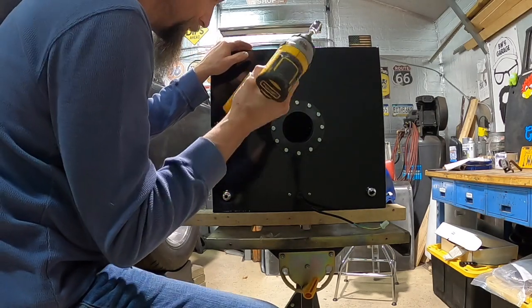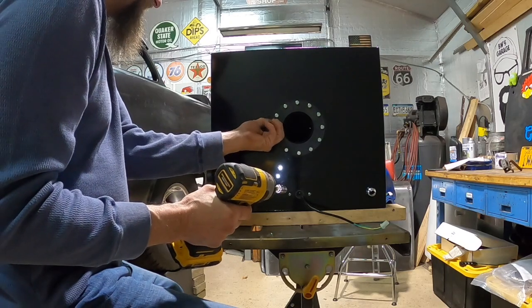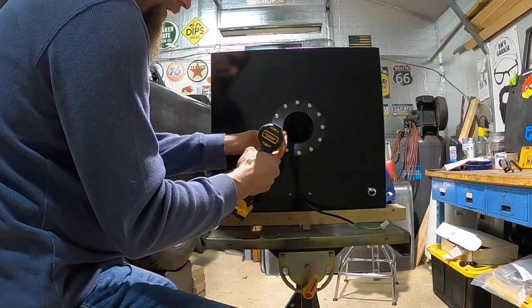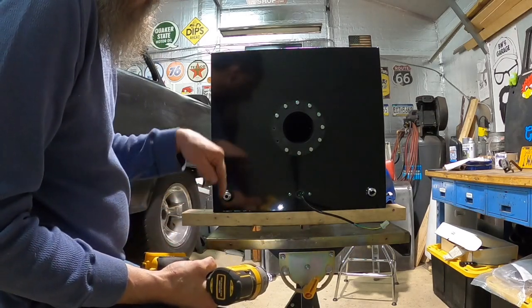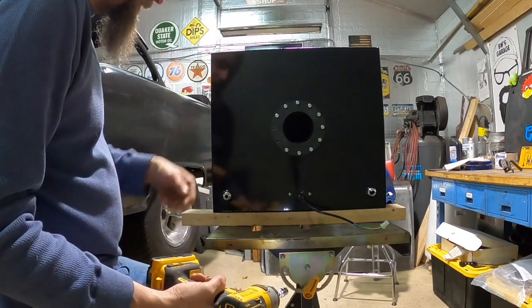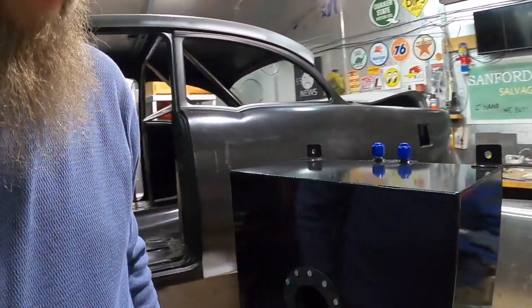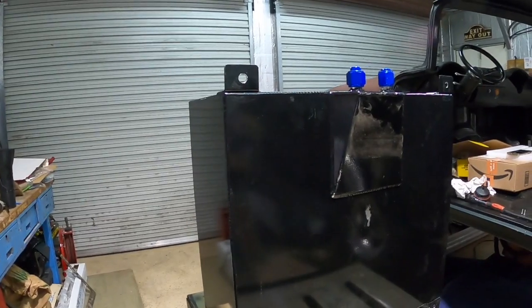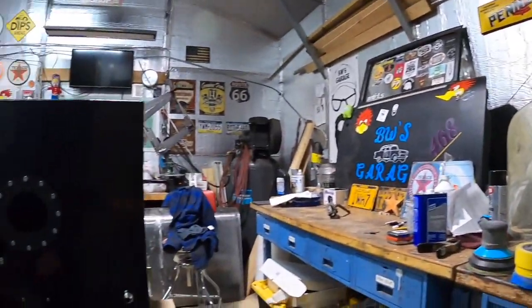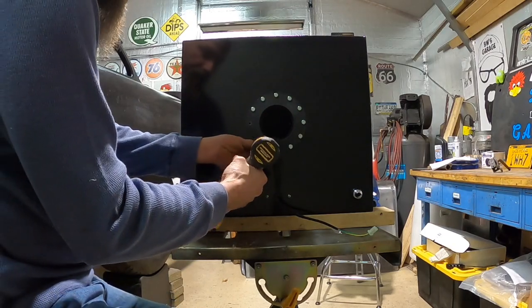We all got 30 or 40 of them and can't find a one — well, I found one of mine. With plastic threaded plastic you've got to be really careful. This is a nice tank though — I got this tank off Amazon and I will put a link to the product in the description below for anybody looking for a fuel cell. It's well built, it really is. It has beautiful welds on it, it's got two vents on the top, a feed and return down here, and it even has a little bit of a sump built into the back. One of the flaws is the sloshing foam, and it doesn't just apply to this fuel cell — apparently it's all fuel cells.